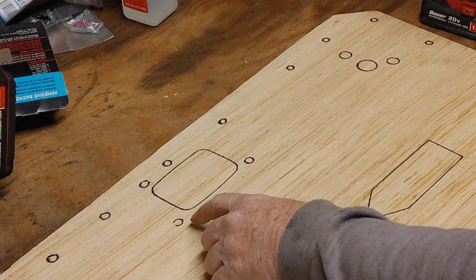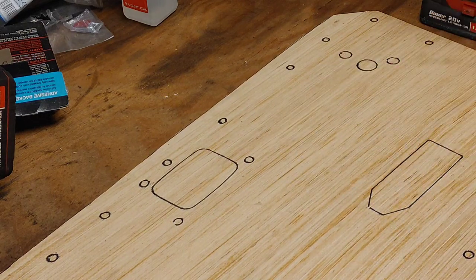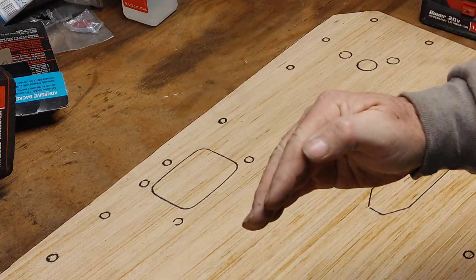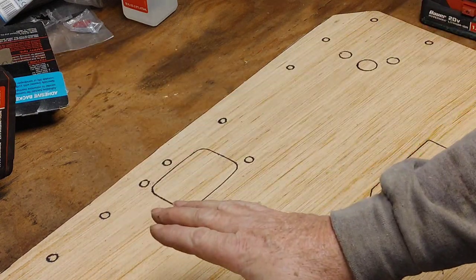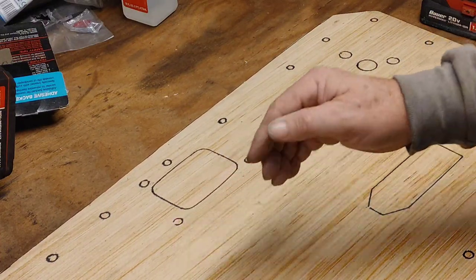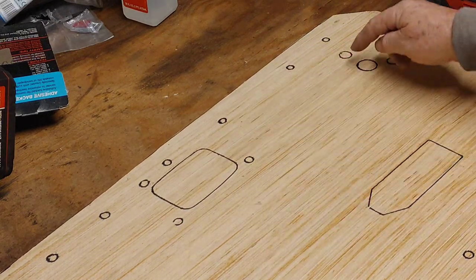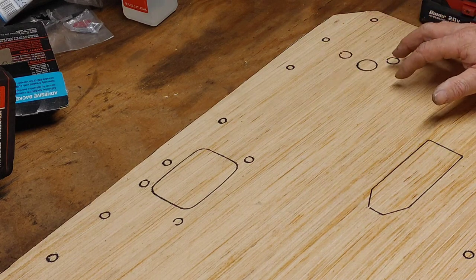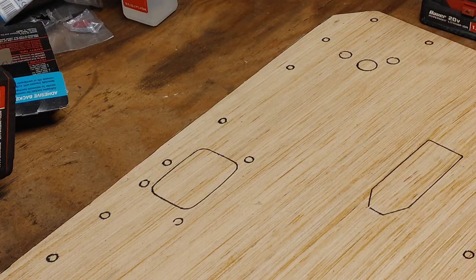I put the pattern back on, lined it all up again, and marked these holes. I looked at the door and the part of the door panel — these bolts sit proud, they stick out away from where the panel sits flush against the inner door skin. So these bolts need somewhere to go; you open the card up and the bolt recesses into these holes. There are two more down here not on the door card — I've got to look into that — but these ones sit proud too, so they're getting opened up as well.